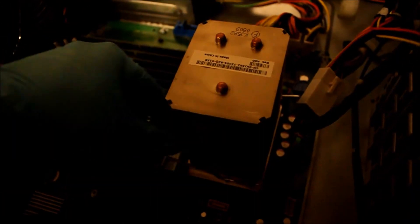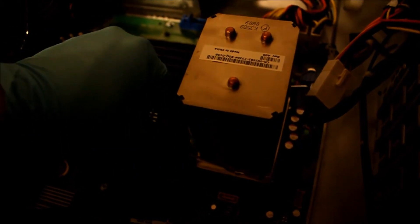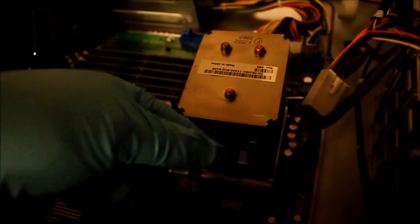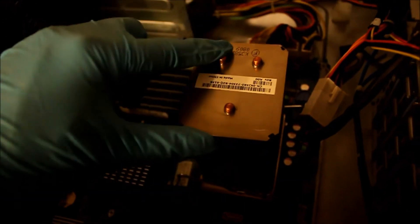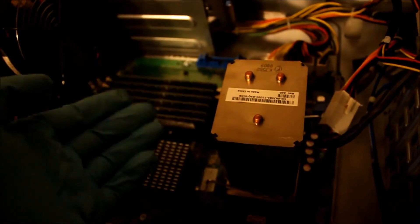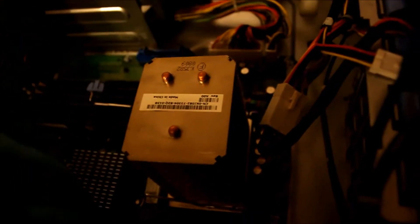What I did is gently push it down and basically push this lever down so you can release the tension and pull it up, like so. Because when you take out the pressure from this angle, you want to hold it and pull it on the other side — that way the heat sink would not curve, because the pressure is on one side and it might lift up and damage the CPU. Make sure you gently push this down while you lift this up, and on your right hand pull this lever outwards to release it.